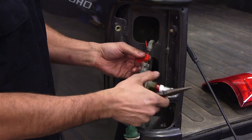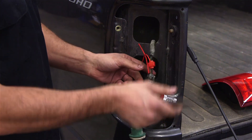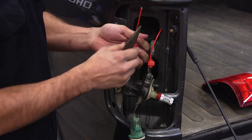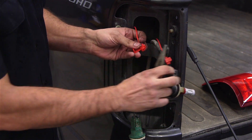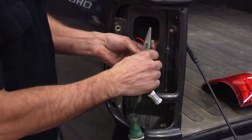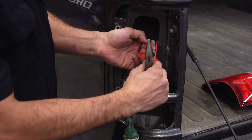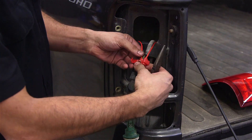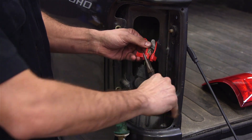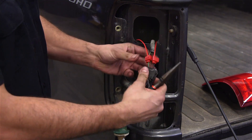Squeeze down with firm pressure and make sure it locks in those wires. Once you've done that, give it a nice tug to make sure they're in nice and tight, then close it up and lock it in. Then take your other quick splice and repeat the process for the turn signal wire — put it on the inside, take your green wire, fit it in the groove, and once it's seated and the resistor is all the way down, apply firm pressure, make sure the metal is all the way down, give your resistor a tug, and lock it in.